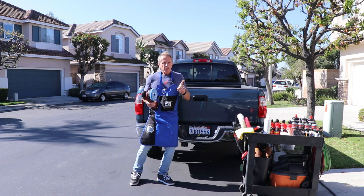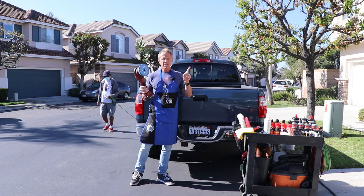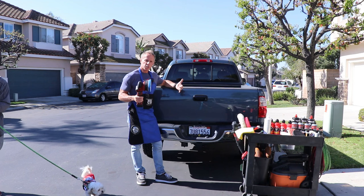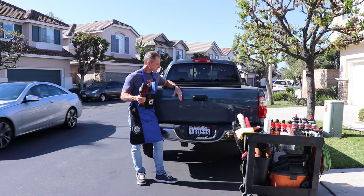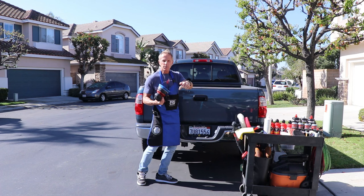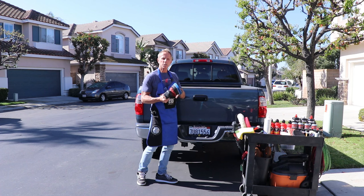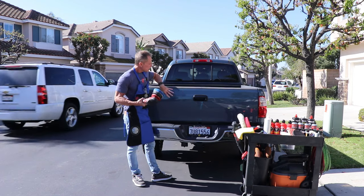As a little sidebar — very few people will tell you this — everything in life has trade-offs. The trade-off with a clay bar is that it will prep your surface the way it should be, but it will do some scratching or abrading in the process. That's a good trade-off, because now you come in with polish and fix that while restoring the shine, luster, and depth of your clear coat.